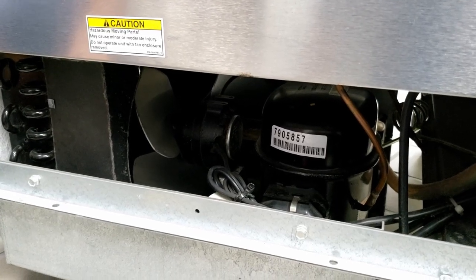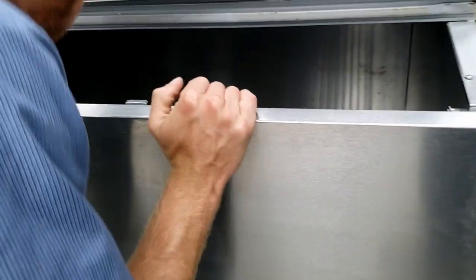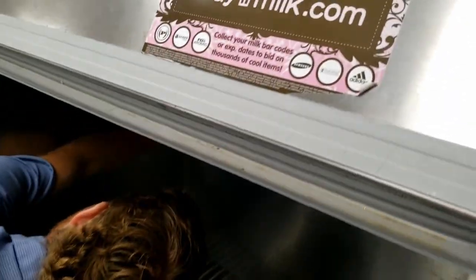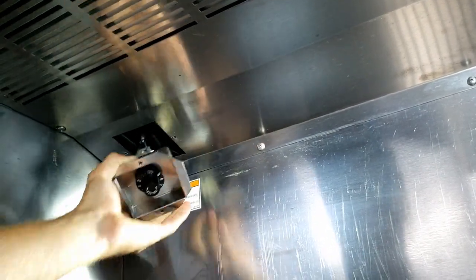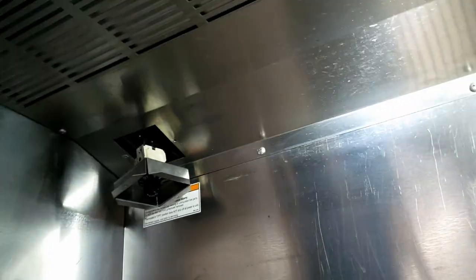What turns it on and off? Thermostat. So where's the thermostat? I would check the thermostat first to see if it's got power. It's probably hidden in there somewhere - it could be on the back. Sometimes they'll tuck a probe up through the back. There it is. What I would do to be safe is unplug it, drop that down, and check to see if you've got power there - once you've got it isolated from all the stainless steel that could short into it - check power to see whether you've got power coming in and going out.